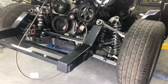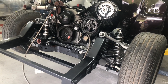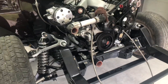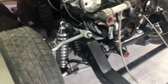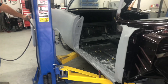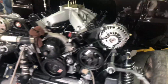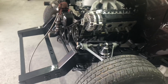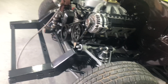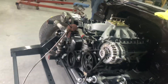Drive shaft's in — that was a bit of a pain in the ass. Drive shaft's in, torque converter bolts are in, transmission bolts are in, all the cross-member bolts, U-joints are in, U-bolts for the drive shaft. Let's see what it looks like on the ground with the weight of the engine on it. Here goes the back, comes the front. Yeah, a lot lower. What would you say — 500 pounds heavier? Maybe 600, 650, 700 with the transmission? At least 750 with the trans, I reckon.